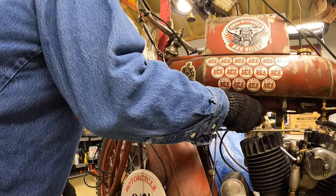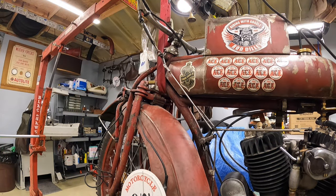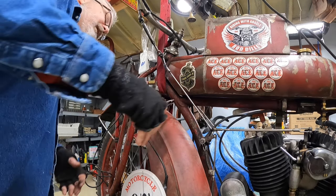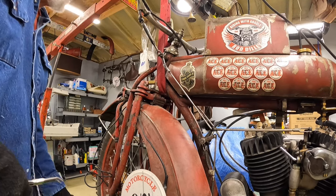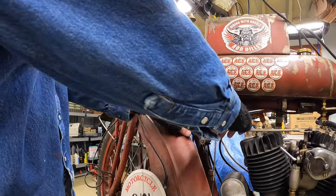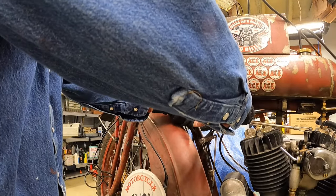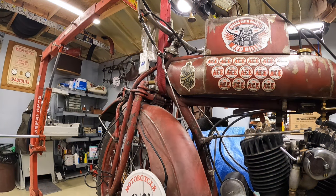And that Loctite, if that thing doesn't want to come out of there, with that Loctite, if you heat it up to about 300 degrees, it'll let go. That'll be easier to do out on the bench rather than here on the bike. So, all right. Take that link loose. There's the washer for that,